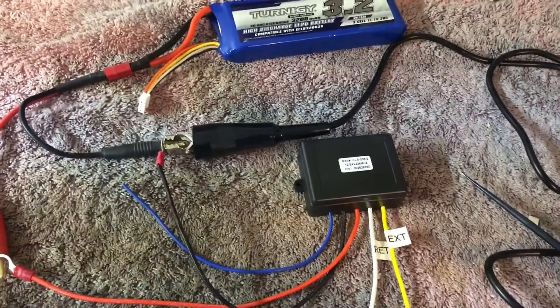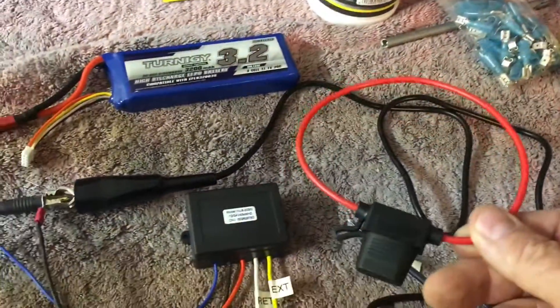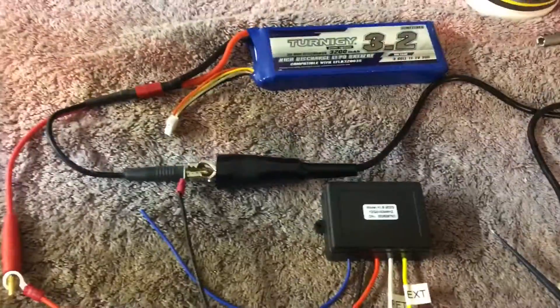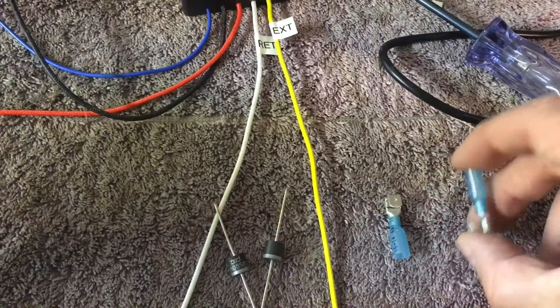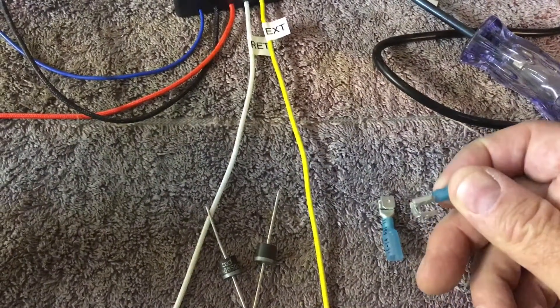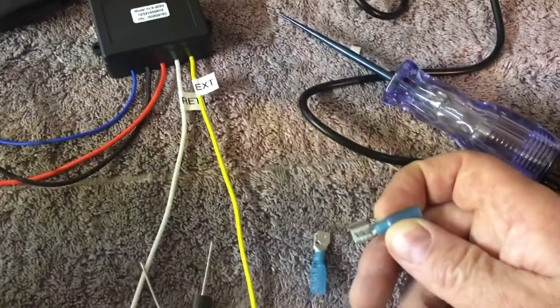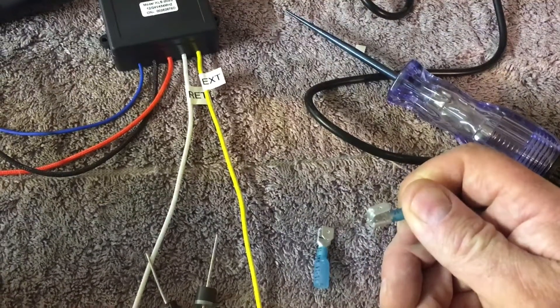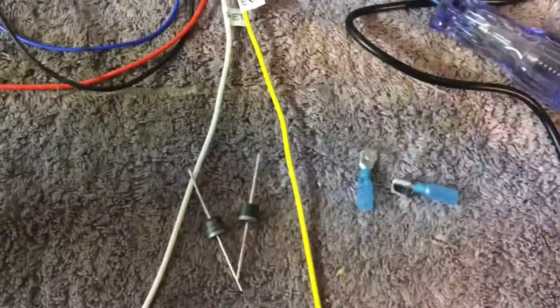That should give me more control for the trailer. As for the rest of the wiring, I'm going to use a typical inline fuse — I always like to protect any circuit. And then attaching the yellow and white wires to the control relays, I like to use these piggyback terminals with heat shrink on them. That way if this ever quits, you can unhook it completely from the system. That'll leave you with both the wired pendant working and the remote working.